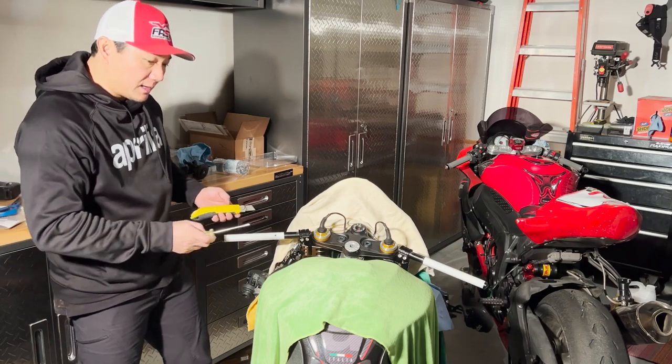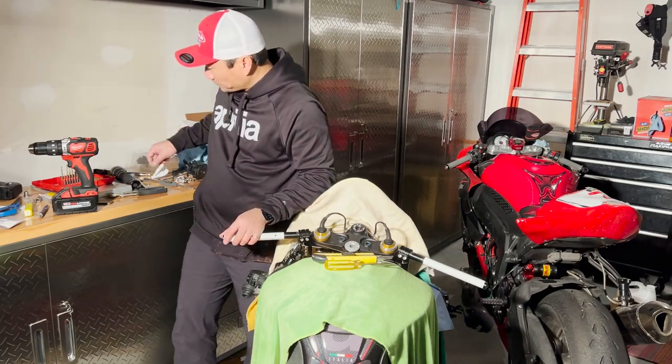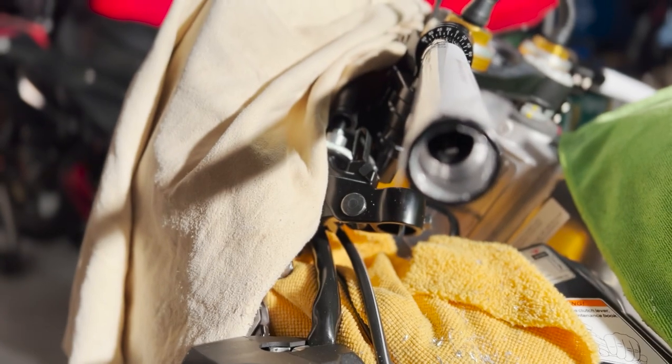Yeah, that's off there. And so I'm using this opportunity to also drill the inserts. Okay, share with you what I just did there. Highly recommend being very, very steady and stable as much as you can drilling this hole, because as you can see, it's nice and well-centered, and you don't want it more than, I would say, about an inch deep. Yeah, about an inch deep is all you need. And then once you get that, you're going to tap it.